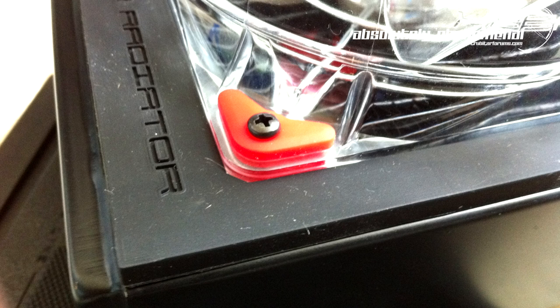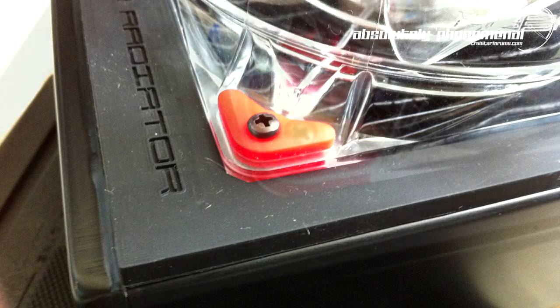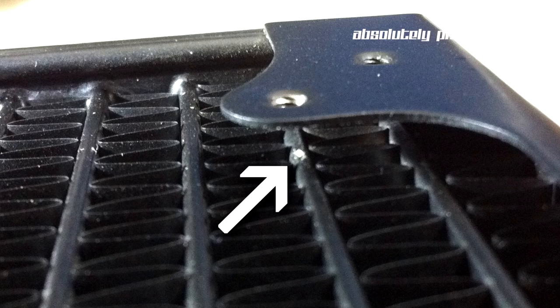During this review it was discovered there is a deficiency in the mounting components for this add-on pack. The M3 mounting screws could be easily over-torqued to the point where they pull through the mounts themselves, resulting in excessive screw travel and radiator water channel damage.